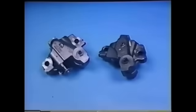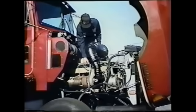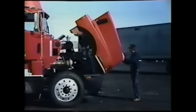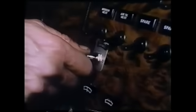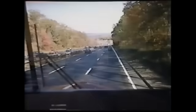The Jake Brake is a simple hydromechanical device adaptable to most high-performance diesel engines sold today. Its rugged design and few moving parts make it ideally suited to heavy-duty vehicle use. The Jake Brake is an engine retarding system that uses the diesel power plant itself to slow the vehicle. The retarder is not a replacement for the service brakes — it is a supplemental braking device completely under driver control that converts a power-producing diesel engine into a power-absorbing mechanism.